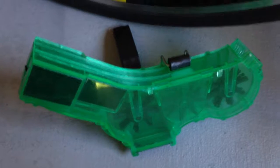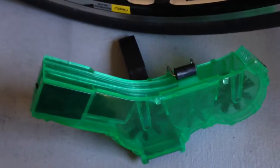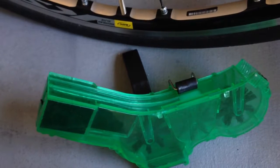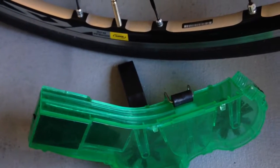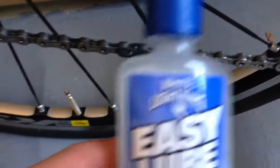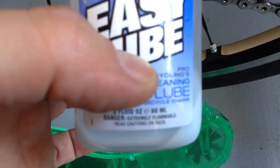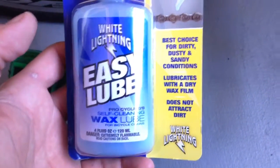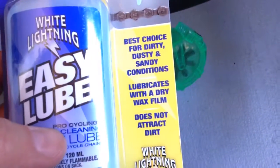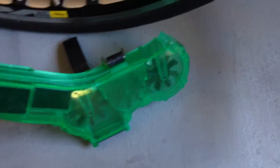Right after I'm done cleaning the chain I want to make sure it's nice and pristine — I give it about two or three passes. They say do 10 revolutions and redo if necessary; I do like 50 revolutions, take it off, dry it, do it again. Then I use the dry lube — this cycling self-cleaning bike lube. I'm pretty much out so I'll open a new one — about 10 bucks, best choice for dirty, dusty, and sandy conditions because it doesn't attract dirt.